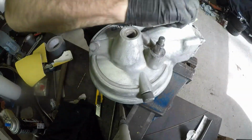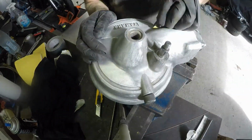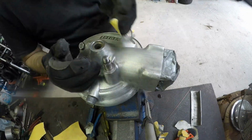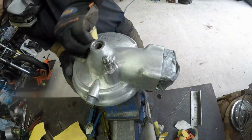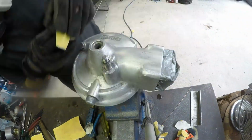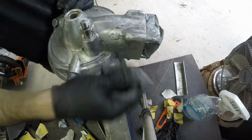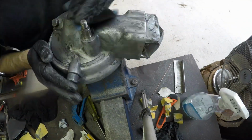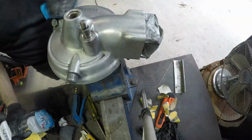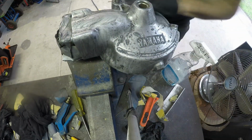The amount of polishing, or the quality of your polishing, is really going to be dependent on the prep work. So the more you're prepared to sand and wet and dry, the better it'll come out. I spent probably 3 or 4 hours on this. There's a lot of little corners that makes it much trickier, but I think it's worth the effort. At this point I'm on to wet and dry, so that's 400 wet and dry, and then I'll go over it again with 600, and then I'll start polishing. You can see here it's come up pretty clean already.